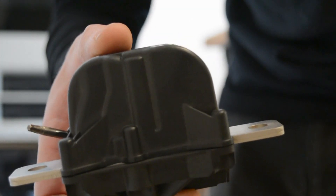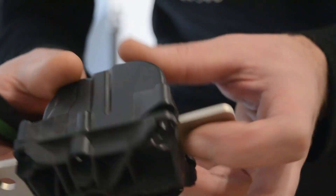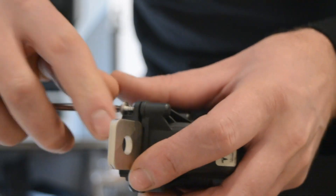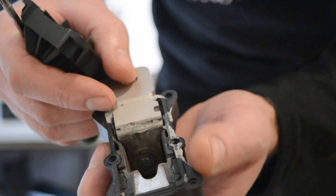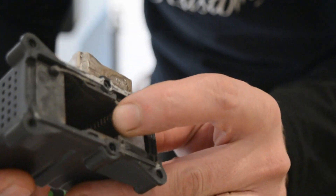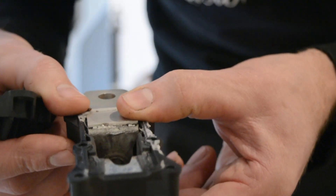If you've never seen a pyro fuse — that high voltage disconnect I was talking about — I've got a blown one here. So buried inside that pack is this high voltage disconnect. Here you can see the connection for the pyro that's inside of it. This is just a big bus bar across. Take this apart and what you'll see is when the pyro blows, it fires this ramp up and splits this bus bar. You can see it punctures down, and deep inside there's a ratcheting mechanism that prevents this from ever re-engaging. So once this blows, it's stuck down there, splits the pack essentially in half.